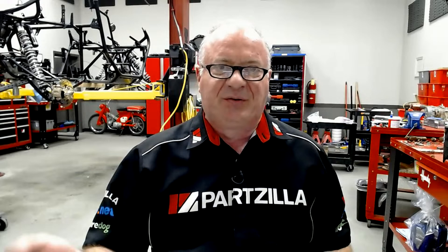BigCG75 — never got the valve clearance specs for my bike, did order a manual supposed to get it Thursday. I may have started out with that information on the stream we had to kill because of no audio, but here are your valve clearances: intake is 0.1 to 0.2 millimeters, exhaust 0.2 to 0.3 millimeters. Make sure you measure them cold. If you're really going to dive into this, go ahead and get a manual — sounds like you've already done that, which is the first step in getting these machines fixed.